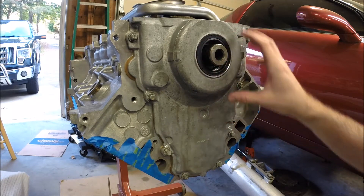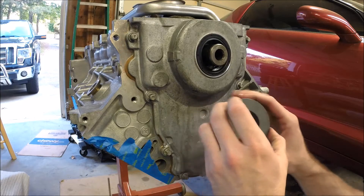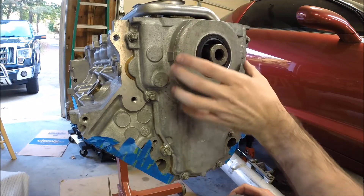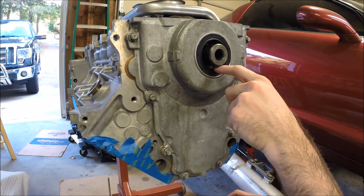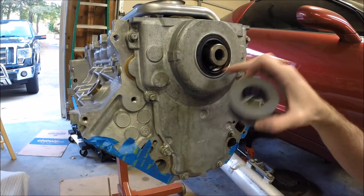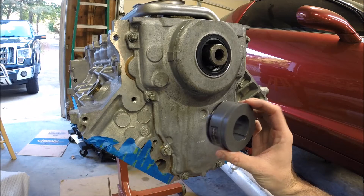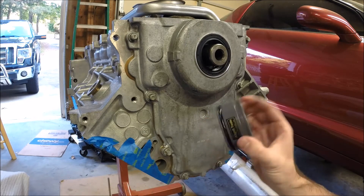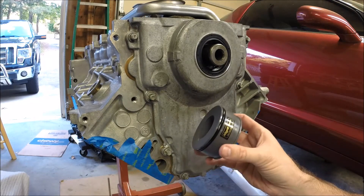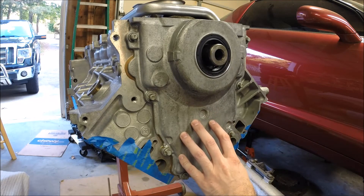Not just installing the seal, but aligning the timing cover. If you already had a seal installed, they also make another tool that's a little smaller that simulates the hub of your front dampener, and you can align the front timing cover based off of that. But the seal has some flex in it, so it's not quite as accurate as using this without the seal installed, so I prefer to use this. This is the plastic version, and it seems pretty well made — good job Sac City Corvette. They also have one for installing the rear main seal, and when we get to that point I'll show you that tool as well. So that's how you install the front timing cover and the front crank seal.